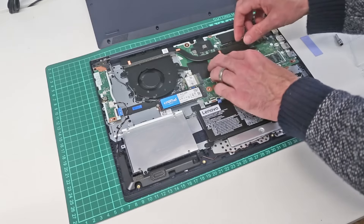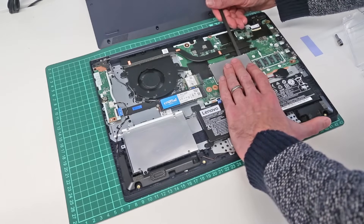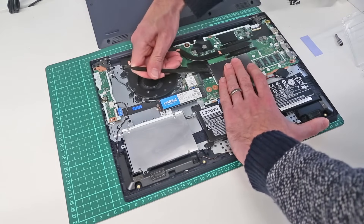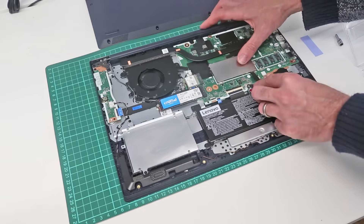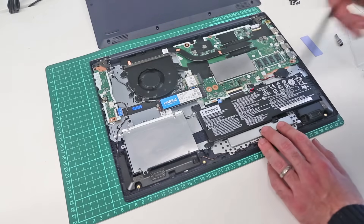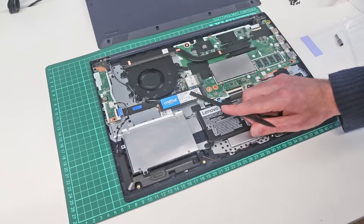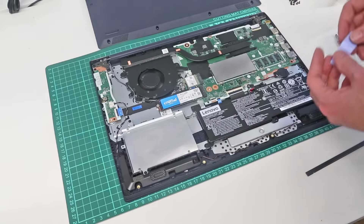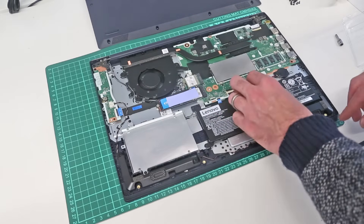With that done, we can refit the cover, making sure it sits between all the clasps. With the SSD, it's worth noting that in this case I am going to clean install Windows onto it. If you were wanting to clone from the original drive onto the new SSD, you would need a USB device which you can fit an SSD into — I'll try to put a link in the description below on Amazon Affiliates. You can either clone directly using something like True Image, or take an image from the original and image it onto the new one. I'm then just going to refit the thermal pad onto the SSD — it's not going to cover the full length, but it shouldn't be a major issue.